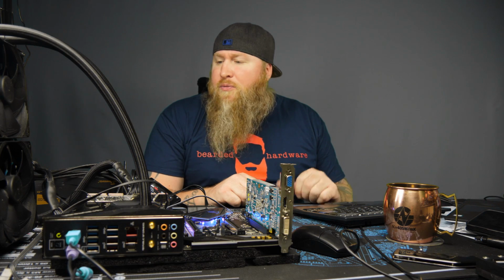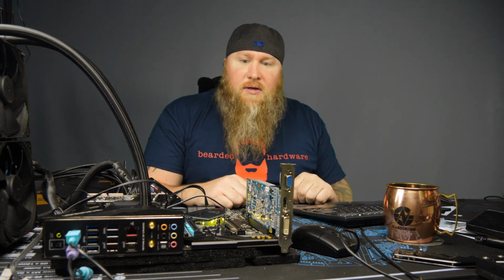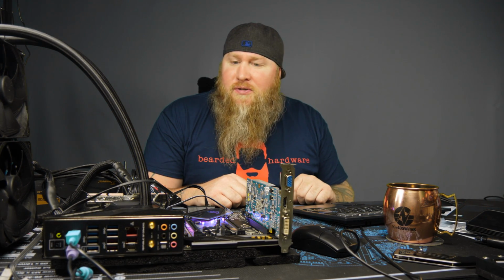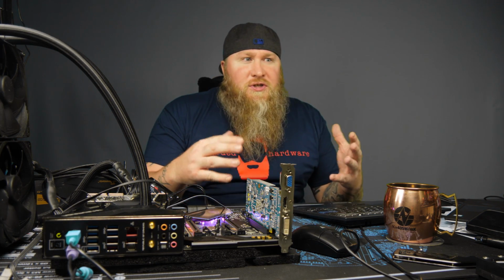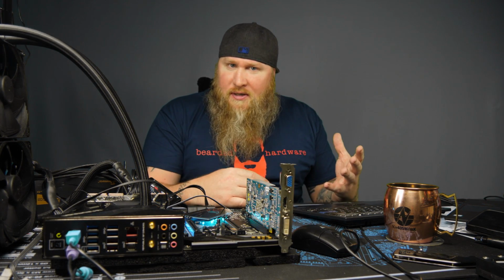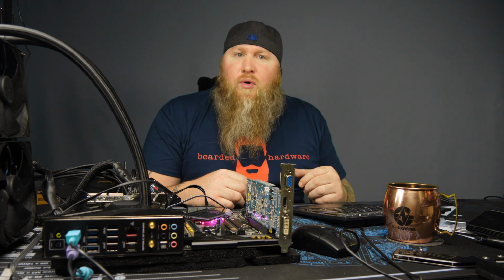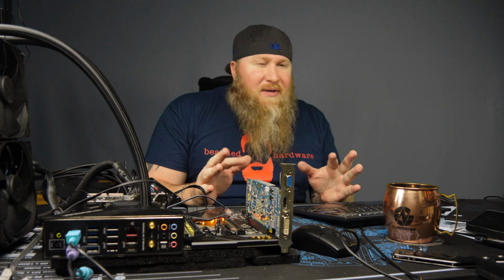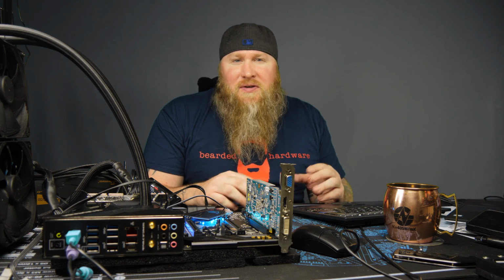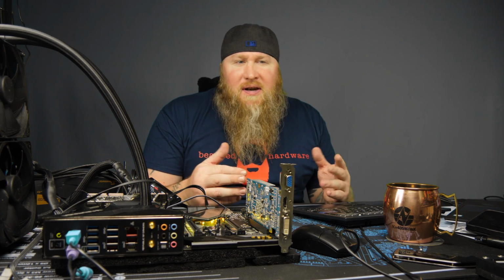All right, Slackers, we just got done and it's some interesting results. So I was just here on the Apex, and the chip that I have in there now, before delid, did about 5.2 at 1.2 volts. The most it would really hit is about 80 degrees. On average, you run between 78 and 81, maybe.